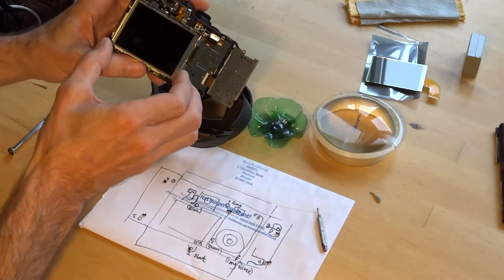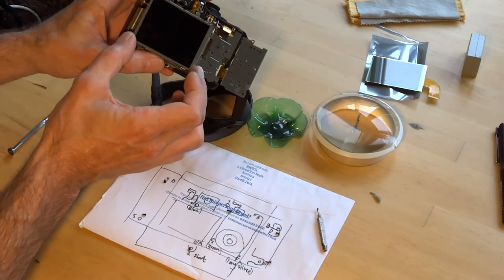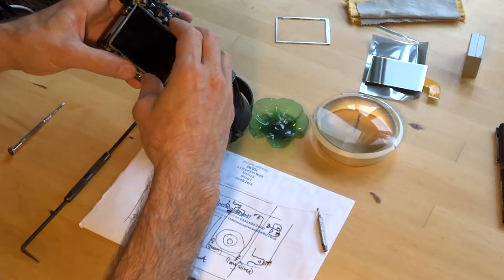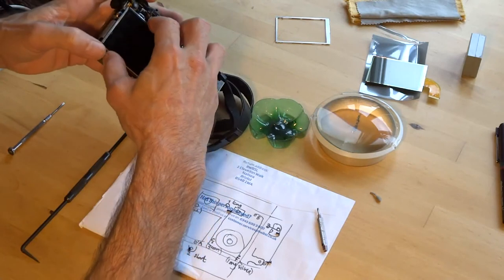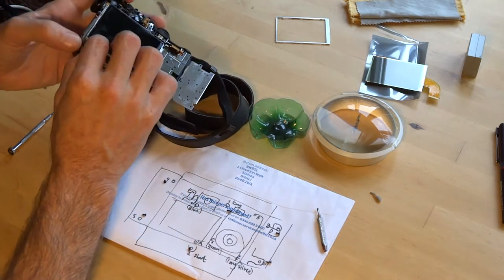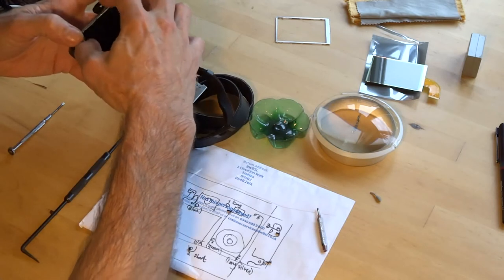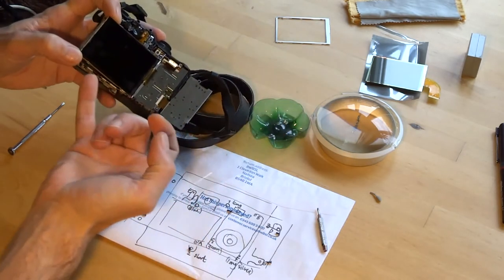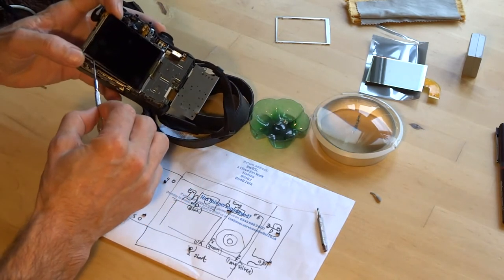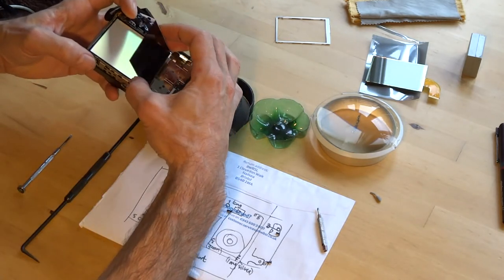Now, the screen has a very delicate cover on it, which you will need to loosen. You can then pop the screen out, which also has a black fitting piece of plastic which also needs to pop out. I've already loosened these. This is what this tool is good for. There you have the back panel, the back light.